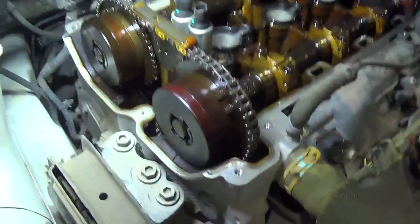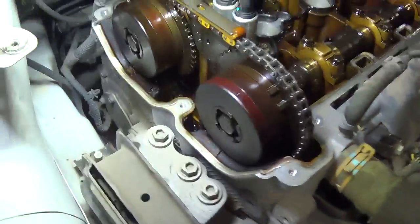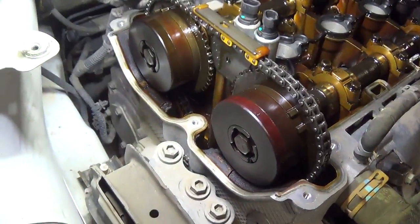So the pressure transducer waveform was spot on. We could see that the intake valve opening was delayed, and I guess around 50 or 60 degrees. We see here it's 47 degrees. So that's fantastic. It kind of proves the point that you can use your pressure transducer to even verify timing.